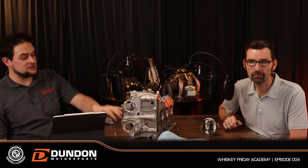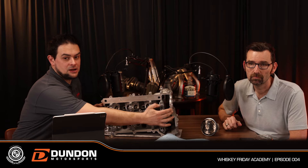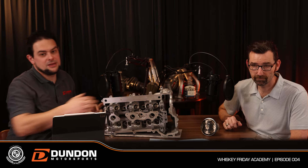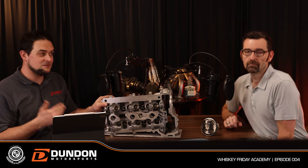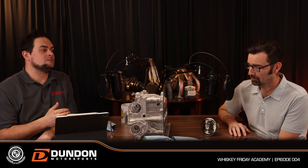You can see on the intake side there's a bulge in the head — a lot of people don't know this. That offset houses a cam adjuster, and it's only on the intake side. This engine has fixed exhaust cam timing, just like a 997.1 GT3. The 997.2 GT3 has both intake and exhaust variable cam timing.